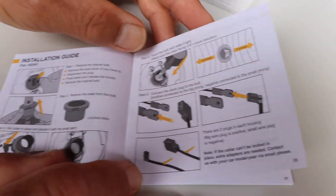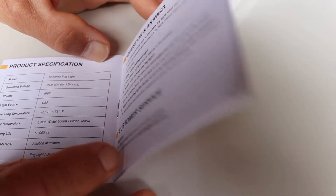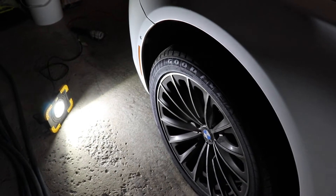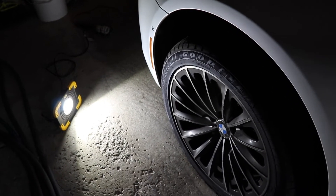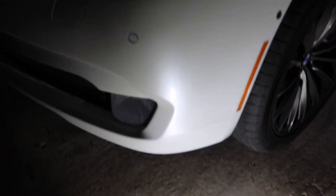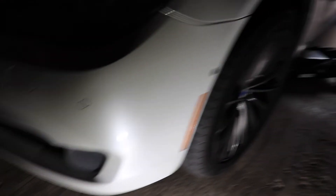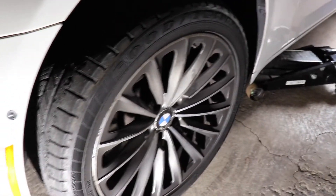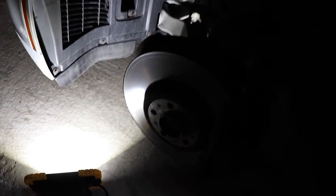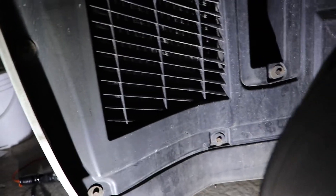It should be fairly simple to install these lights. It does give you some Q&A sections in case you need it. First things first, we need to open up the bottom to be able to get to the fog lights and replace them. There are two ways about doing it in every car — you can either open up the whole bumper and grille, or in this case we're going the easier route, through the tire and the bottom part of the bumper. We need to jack the car up, then open the wheel well compartment to get to the fog lights. Now we've opened up the tire and we need to open bolts all around to get to the fog light.